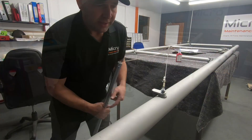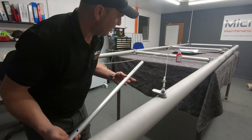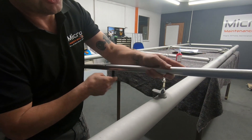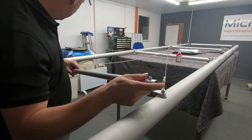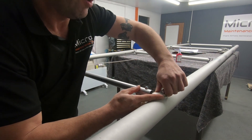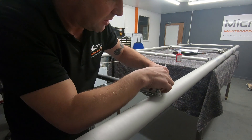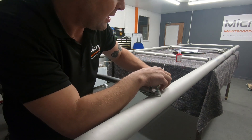Make sure it's that way. Now we've got the cables fitted both ends with the adjustments done. Take this bar — this is the tensioner. You'll see there are two holes and they're not all the way through — just on one side — with a nut and bolt on this side. That goes this end; find the locating slot. You need a little bit of movement in there, which is why it's important to get it the right way — it just slots in there. Once that's done, we can add a little bit of tension on the turnbuckle and start seeing it all take shape.